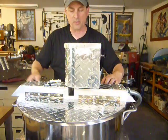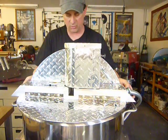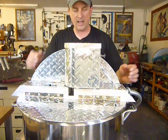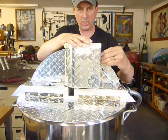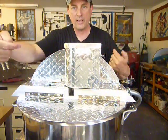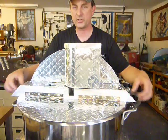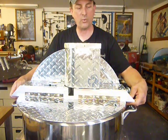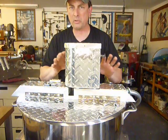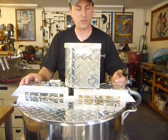When you take this out and put it in the bowl, you're going to center it — just look down the shaft and eyeball it. You don't need to get too perfect; just look in the side and say, 'yeah, that's pretty close, that's pretty even.' That's your starting point. Once you get it eyeballed straight, you're going to turn it on and move it this way and that way — back and forth and side to side — just push it around because these little bolts aren't tight yet. Get it just about where you want it, and then you'll stop hearing the noise and the scraping. Then you've got your height adjustment just right with the washers. Once you've got it all set and turned on, you're ready to pop.